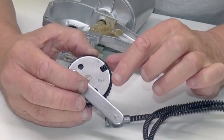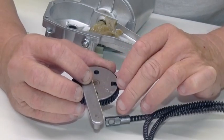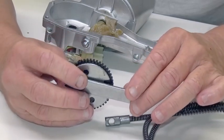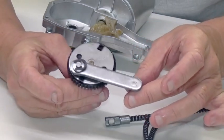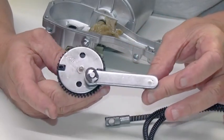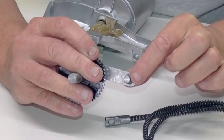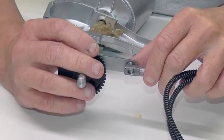This is a 110-degree sweep angle gear — it's stamped on the front plate of the gear, but they are available from 95 degrees right up to 140 degrees sweep angle. This is the shaft that goes along and pushes and pulls the cable as the gear goes round, and there's a pin on the back of the shaft that locates in the square block on the end of the cable.